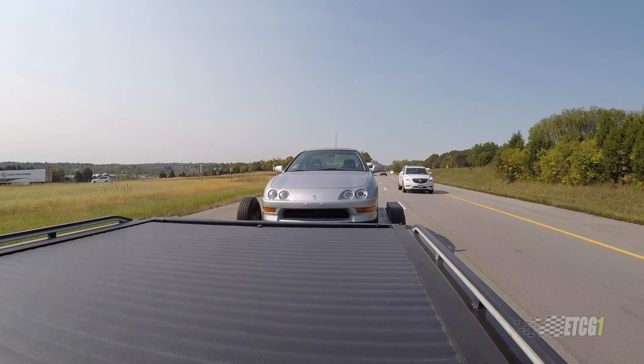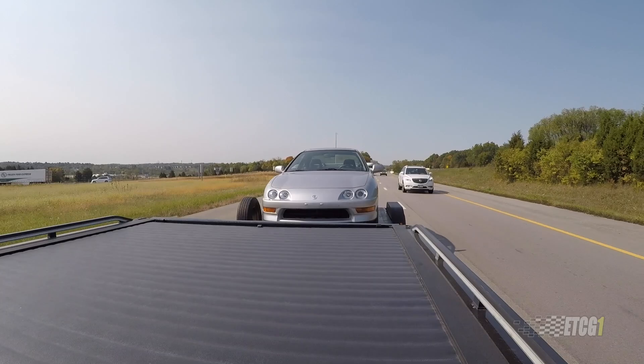Conclusion: airbags are the way to go. If you're going to increase the load hauling capability of your truck, airbags are the way to go. No substitute for a longer wheelbase though — that would help considerably. Next to the rear stabilizer bar, this is the best upgrade I've done to the truck, easily. I'm hearing some pinging — possible detonation or pre-ignition. I run it lean at cruise but with towing I think I'm going to richen it up a little bit. Let's turn around and head back.